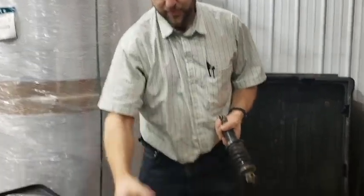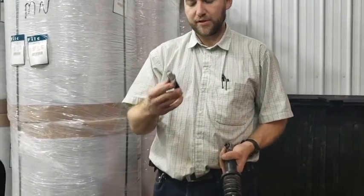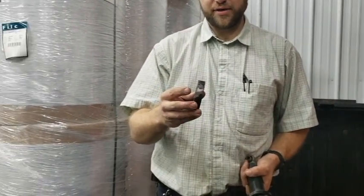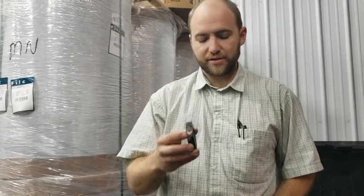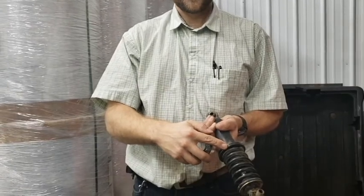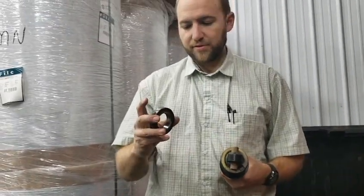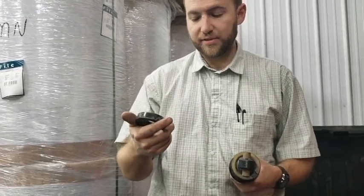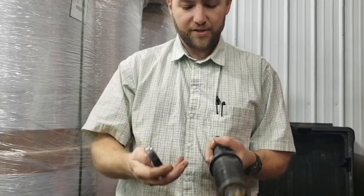I got these shims from a shaft that was laying around and I cut it with my bandsaw — really simple to fix. This is a 5/8; some people might like this if they have bigger tires, but I got too much positive camber with this, so I'm backing it down to the 5/16s. Some people use plastic PVC that they cut — I personally don't trust plastic, some people say it works fine. I just used a shaft I had laying around.